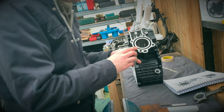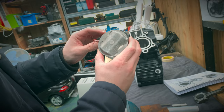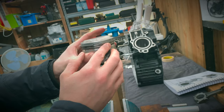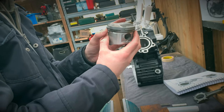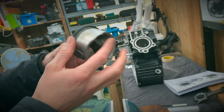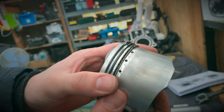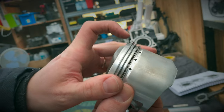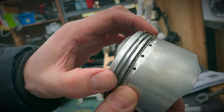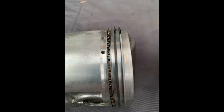Okay, also another note, I got these from CMS, it's hard to get the OEM things. Orientation is a bit weird because there's no instructions about this. So searching forums and online, and I got a diagram from the CB forum actually. But what we think is, try and show you. Yeah, okay, so the one with the chromium tip, it's got like two chamfers, which is a compression seal, is the top.